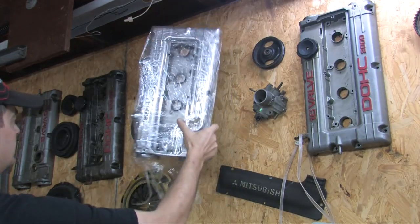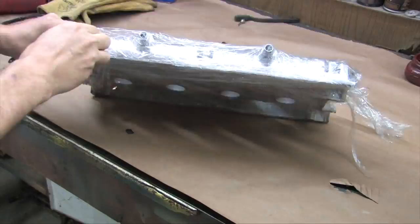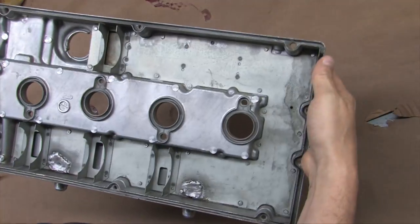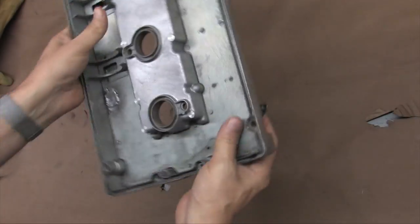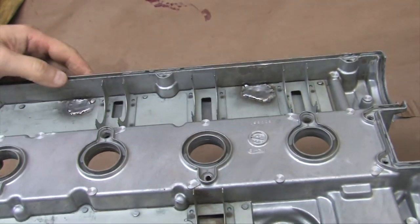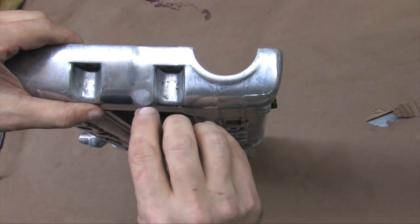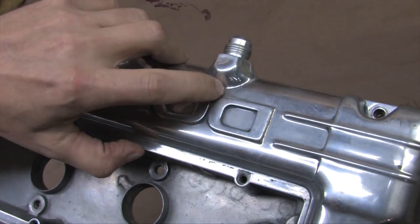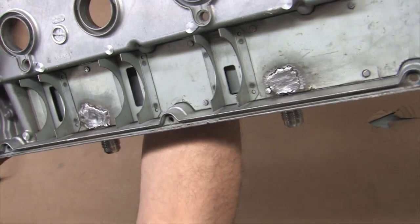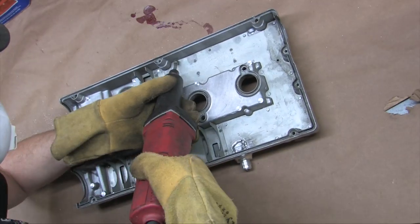Back to the parts wall — I'm getting the clean valve cover down for the GSX. I did some extensive modifications to my valve cover's breather system: two AN fittings were welded on and the buildup was sanded and polished beautifully on the outside. But everyone who welds on cast parts finds out quickly what a disaster it is because of how porous it is. Tiny pores all where the casting and welding meet caused the casting to weep oil — not enough to start a fire, but enough to dull the polished finish and be a nuisance.